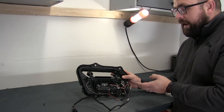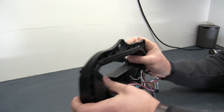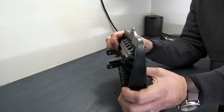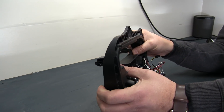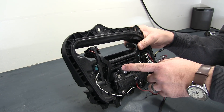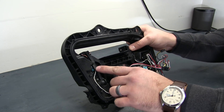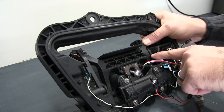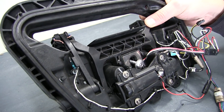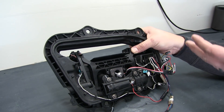The first common issue is the door handle will come out, present itself, you'll get in the car and drive off or park it, and it never comes back. The reason that happens is because of these two micro switches here. When fully operational and the handle presents itself, these micro switches click and tell the door module that the handles have been presented and need to be retracted at some point.